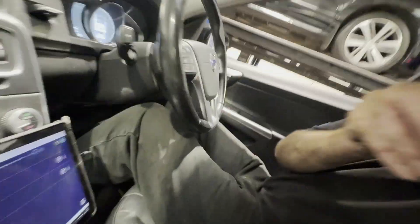I've plugged into it and we've got a code in for the front axle sensor, signal too low — a permanent code. So I'm going to get it sent up on the ramp, wheel off, and we'll have a look at the front axle sensor.